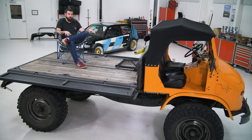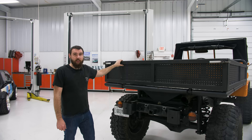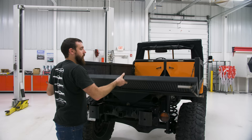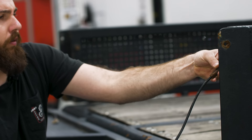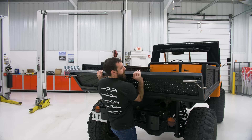As far as the bed goes, it's all fabricated steel tubing around the outside. There are three tailgates, all of which are easily removable. My whole plan behind this was to have no tools needed to utilize any of it — to remove tailgates or open anything. I made these latches for the rear one on both sides. You can just open these and it folds down, and I've got traditional tailgate straps you can undo relatively easily. You can fold it most of the way down or pick it up at a 45 and it comes off.